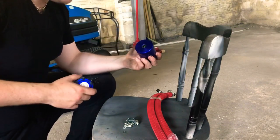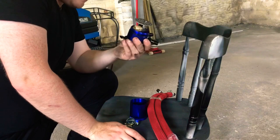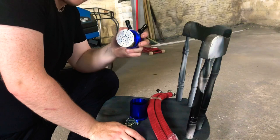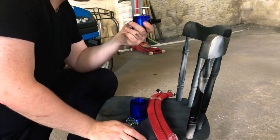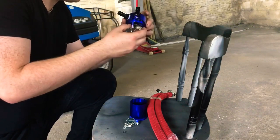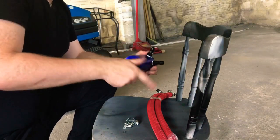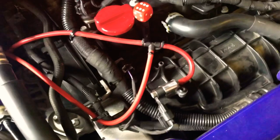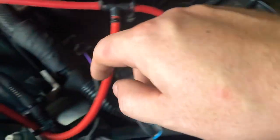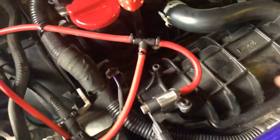So there's the oil drain if you want to drain it from underneath, and here is the filter system. It is a very well constructed piece of equipment - I've seen a lot more expensive oil catch cans made a hell of a lot worse than this. The filter is absolutely tiny so it should do a good job preventing any oil from going back into the engine. In order to fit this can to your system you need to take the existing hose - this black corrugated looking thingy - and cut into it, then clamp on the ones provided so it meets in the middle.